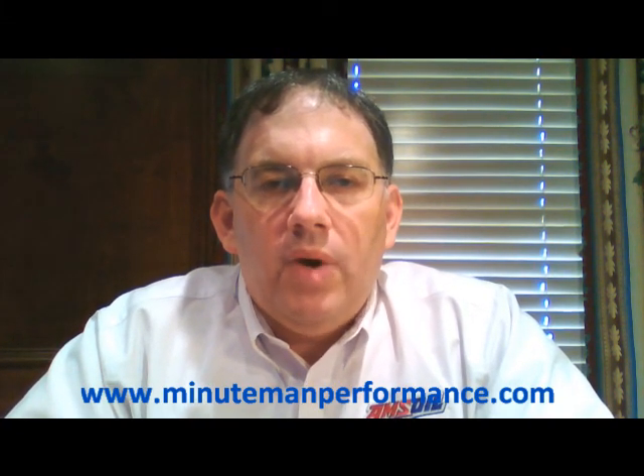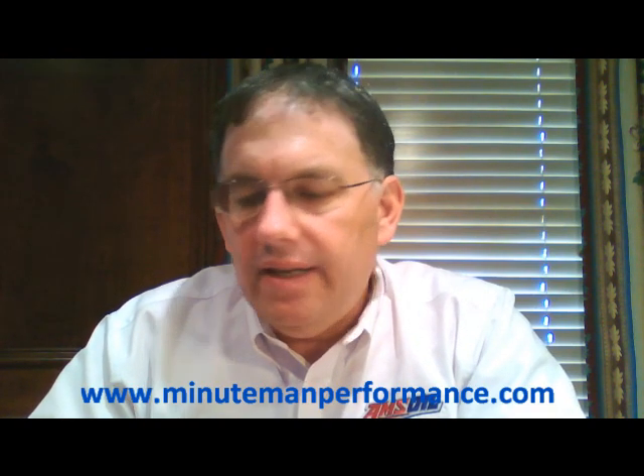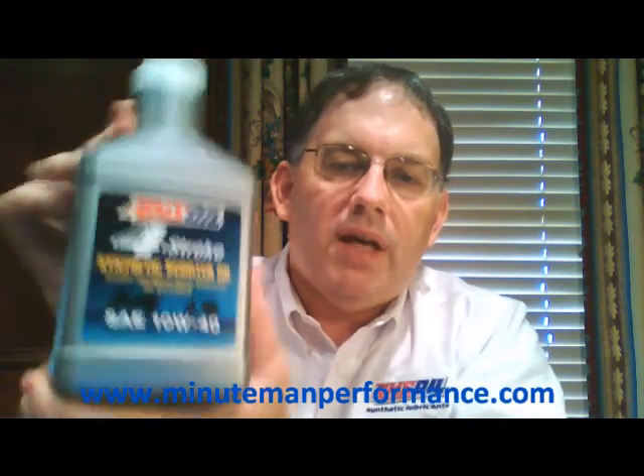There's absolutely nothing wrong with running the 10W40 motorcycle oil in your scooter — it's just more than you need, and you end up paying for more protection than you'll ever use. That's why the scooter oil is positioned right where it's at. It's got a really good reputation and works very well in four-cycle air and water-cooled scooters. It carries an API service rating of SG and is also JASO MA and MA2 certified for wet clutch compatibility. If you have a scooter and you've been looking for a better oil, here's AMSOIL's 4-Stroke Synthetic Scooter Oil in 10W40 — you'll be very pleased with it.